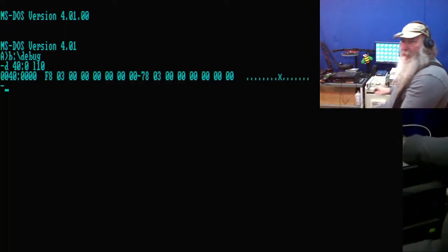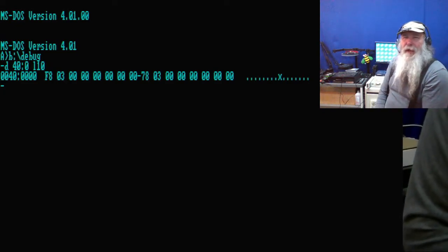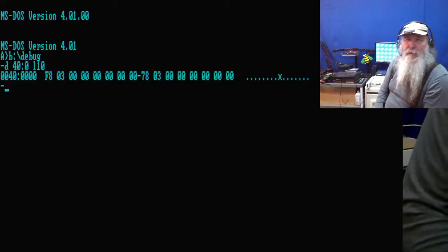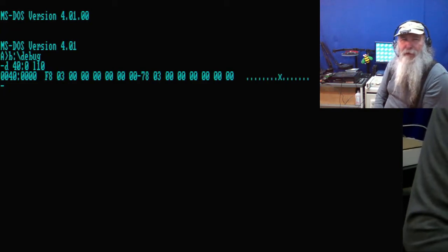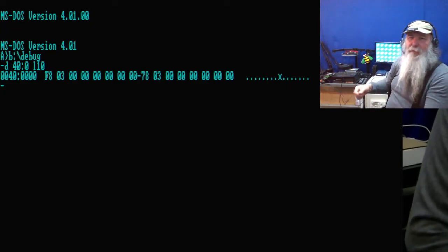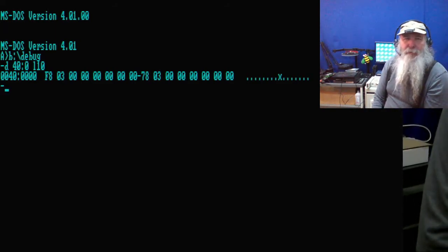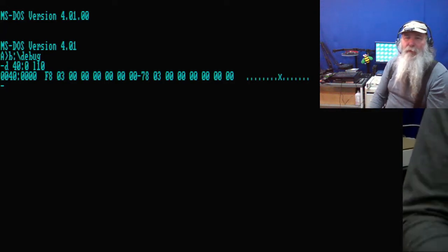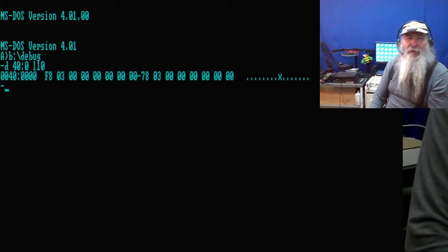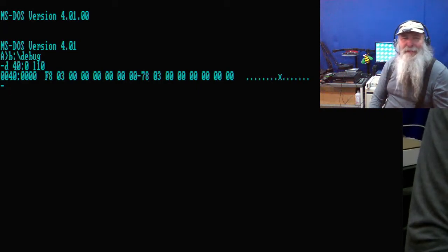And we don't need a space in there. It understands that. So despite all that, we stacked. And that's why I didn't want to necessarily have the zip drive involved in that either. And that's as easy as we can just swap back to the original diskette that we had with the DOS. Because I didn't want it to get mixed up of, okay, if there's more than one parallel port, which port am I on, et cetera. So this just shows the single parallel port, the single serial.